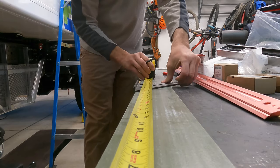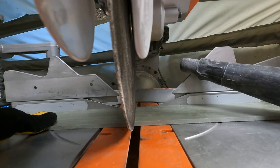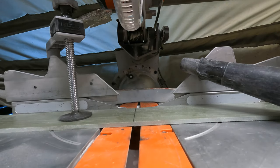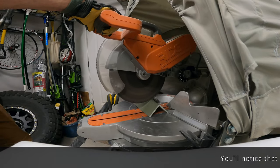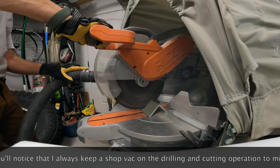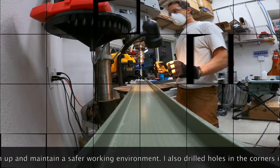I got busy cutting these u-channels and bars of the same width and thickness. The idea is I can put bulb seals on the ends of these sections, compressed up against the camper, and also put some cushioning insulative foam in between the two. These were then adhered to the Earth Cruiser fiberglass pass-through frame with a very strong structural adhesive sealant made for marine applications — completely water resistant — and I'll show you the finished product shortly.